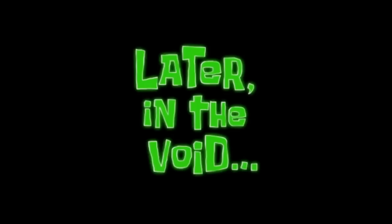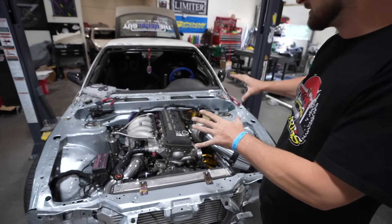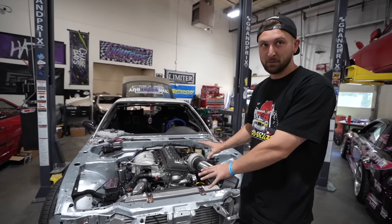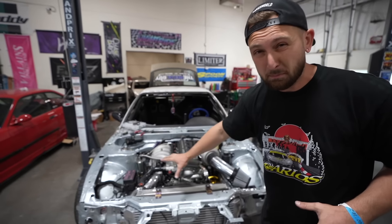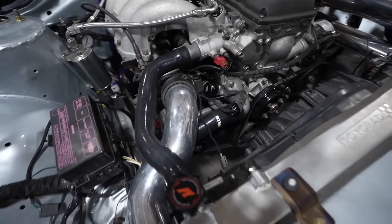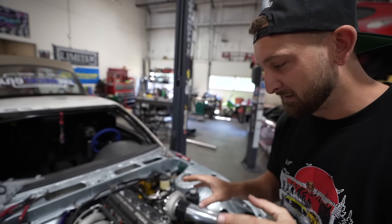Making more progress the next day. The host has been going through the car tying up loose ends — the fuel system is finalized, everything's tight and ran, vacuum lines are all good, wire harness is in place. Still need to put an intake air temperature sensor in and install the wideband, but could run the car without it. Really want to hear this thing run today.